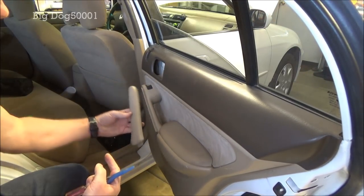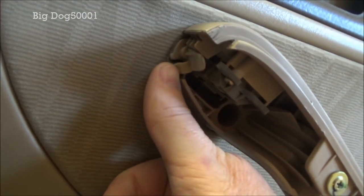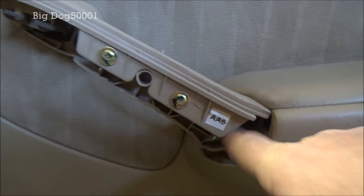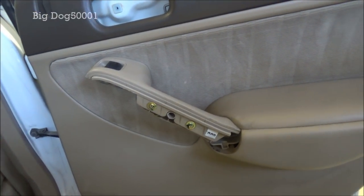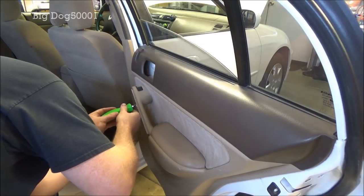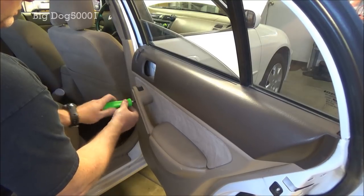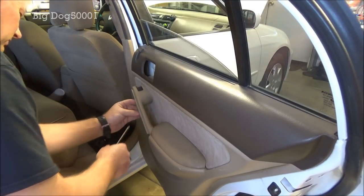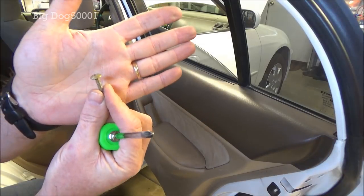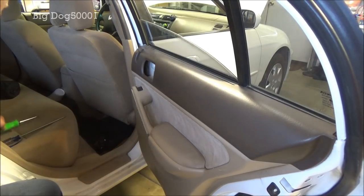You can see that sticks in there — that's what I'm pressing up on with the screwdriver to pop the thing out. If you look closely we should have a big screw right in there and one over here securing this handle. We need to get both of those out to get this door panel up. There's one screw and the other one requires a longer screwdriver.